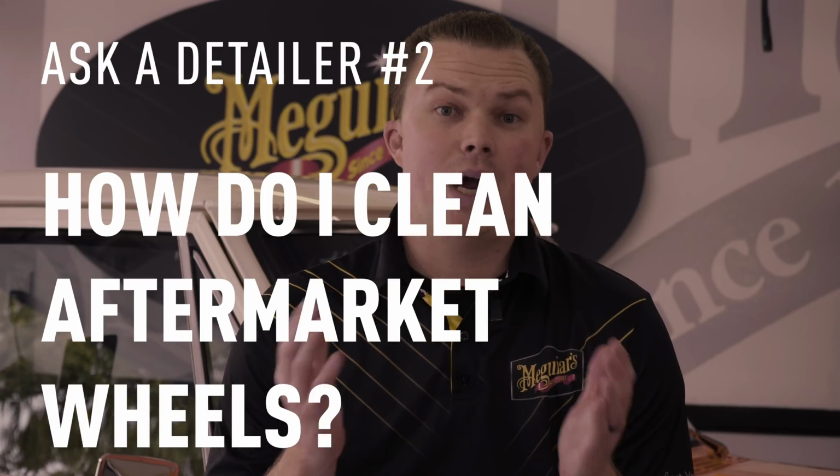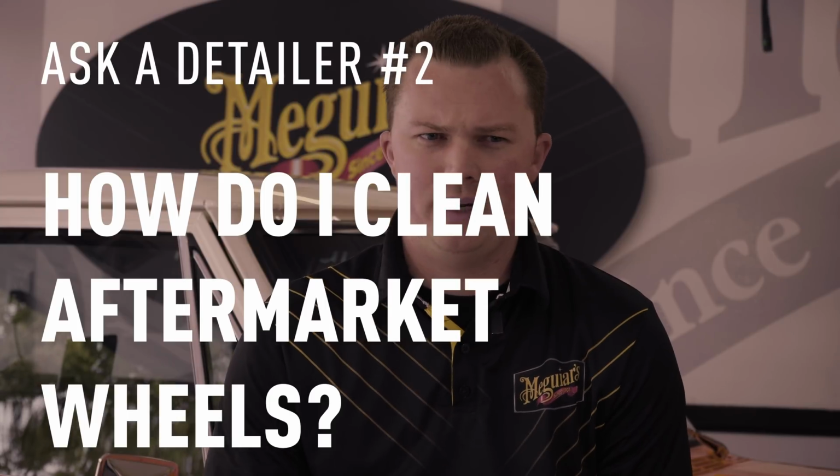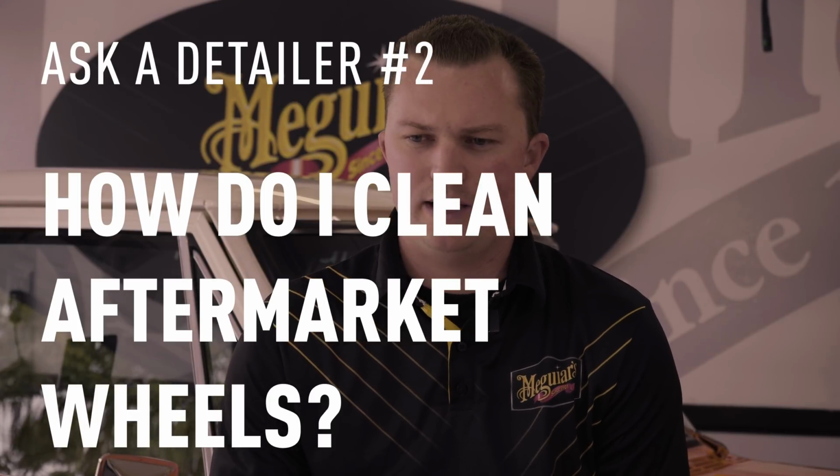There are a variety of types of wheel materials. You could have polished aluminum, you could have anodized or magnesium, you could have a factory clear-coated wheel, you could have chrome plating. Different wheel materials can be more sensitive to certain types of wheel cleaners and how aggressive that wheel cleaner is. So identify the type of wheel and then choose the right wheel cleaner for that material that the wheel is made of.